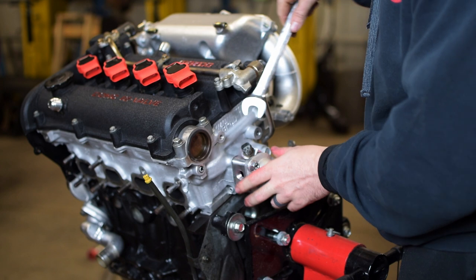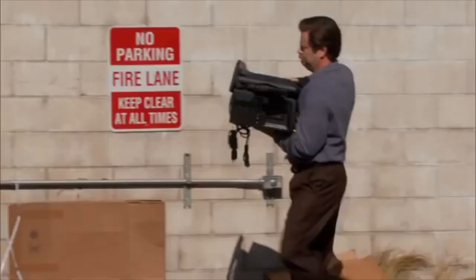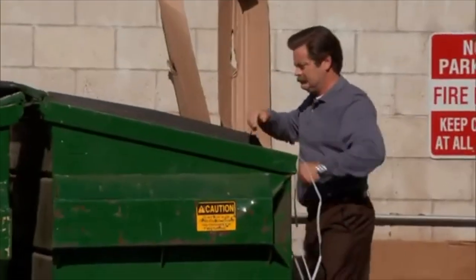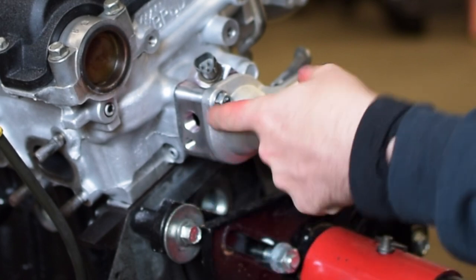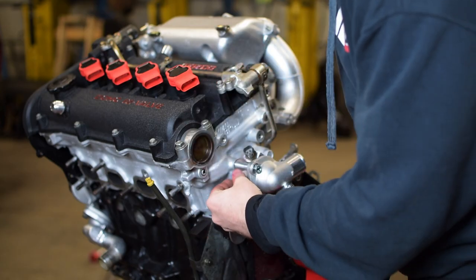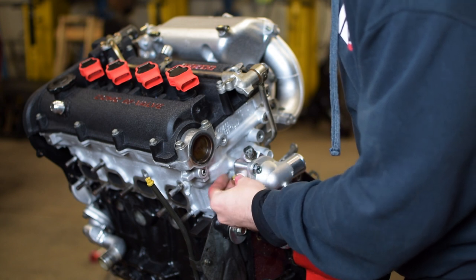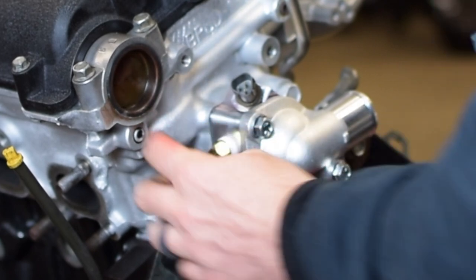Since we've got room, we'll do it now. The coolant temp sensor is vital — do not forget this piece. It's a 19 mil and we're just going to thread it right into the top port. This is why they want you to do it off the car. There is a crush washer in there — just tighten it until you crush the washer. We're going to leave the bottom port open for now and patch it with a 3/8 MPT plug from Lowe's. If you're doing a street car, you'll be installing the parts they give you.